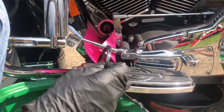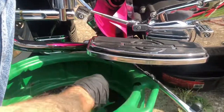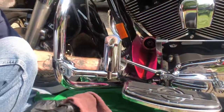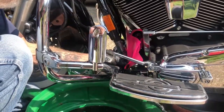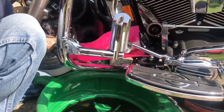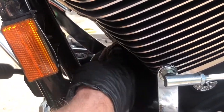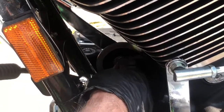Sometimes the oil ring is left behind and you don't want to double them up, because then you'll get an oil leak when you put the new filter on. So always make sure you check that. After letting the oil drip freely from the oil filter, remove the plastic wrapping. Now I'm going to spray a rag with brake cleaner and clean the surface. The better the surface is cleaned, the better the seal will be.